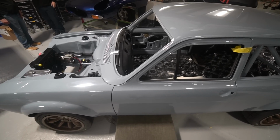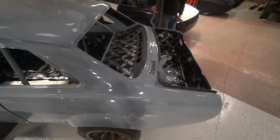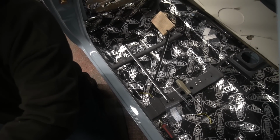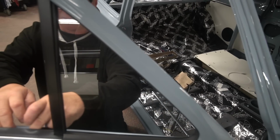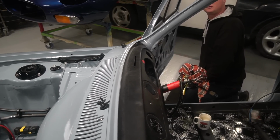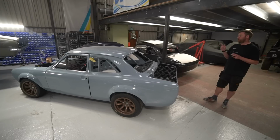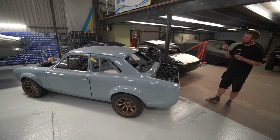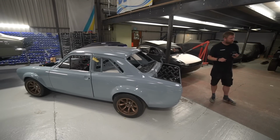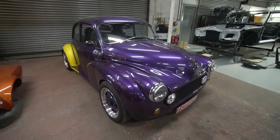And then Anthony's actually been working on the last bit of the door glass area, which was the inner waist seals, I suppose they are. Because we originally had the wrong clips. There's a couple of suppliers out there, they're actually advertising the inner clip, which is not the right part, and we didn't realise this when we ordered it, so I've just ordered the correct inner ones from a company that, this is actually useful information, if you're ever after trim clips and that sort of thing, there's a fantastic company called Bresco which do the vast majority of the clips that exist in terms of attaching bits of trim. So they do the exact original Ford type of clip for these, because they rather than just pushing onto the flange, they have a little tag on them that slots sideways into a square hole, but they are different on the outer to the inner, and they do both types. So useful contact, Bresco.